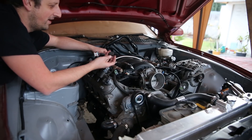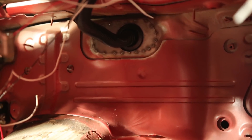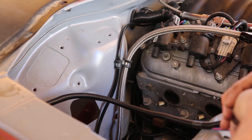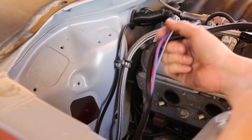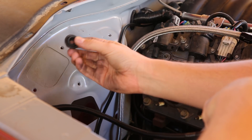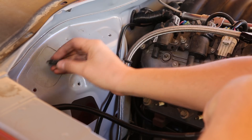I just found my missing tripod foot - much better now. You can see where it goes to my grommet on my little welded plate there, then it goes up and attaches with zip ties to the crash bar up top, and then just goes down on the side. In the daylight it looks much cleaner and much safer than the old version with wires running everywhere. Now I'm going to figure out how to run my wires from the front of the car - headlights, radiator fans, and such - through the firewall. I took an old factory rubber cap from the engine bay and drilled a hole in the middle of it, and that's going to be my little grommet. I'll drill a new hole in this cap the same size and run this straight through there into the cabin.